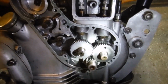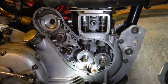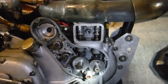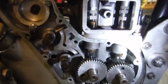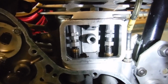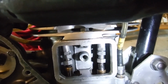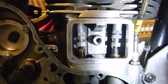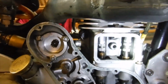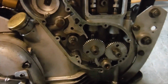I'm working on the exhaust one at the moment, and I know that I've turned the engine over successfully with no clearance, no free play on the exhaust push rod, where you can just sort of spin it, which is how you're meant to have it. But just to make sure that I had a margin, what I've done, hopefully we'll be able to see it, if you look at the push rod, the hexagon on the push rod itself, the body, and the lock nut under it, that gap shows us how much I've lengthened the push rod by, from nil clearance to, if you like, a negative clearance of that amount there, which is probably about 1.5 millimeters. And I've made sure that I can still turn the engine when that valve is going over full lift. So I know that I've got a safe margin there.